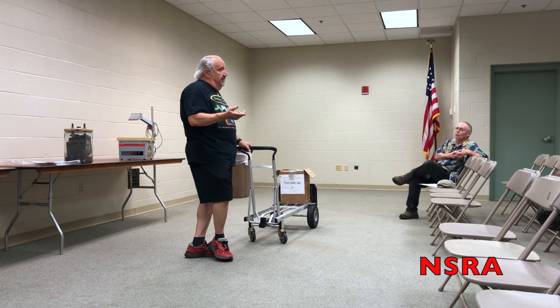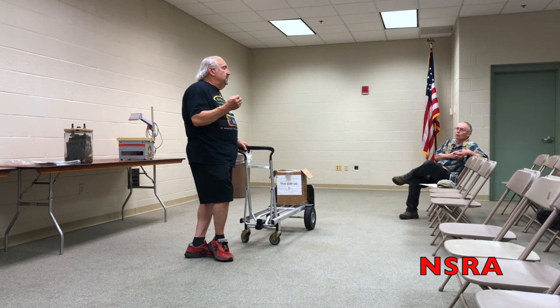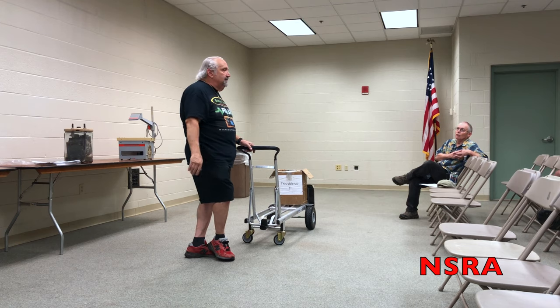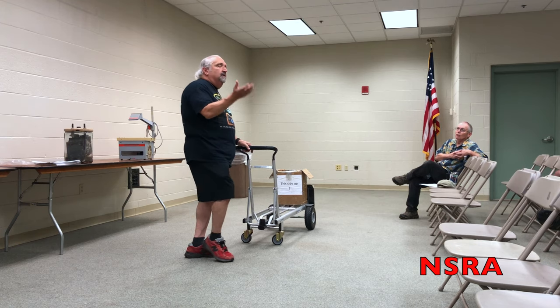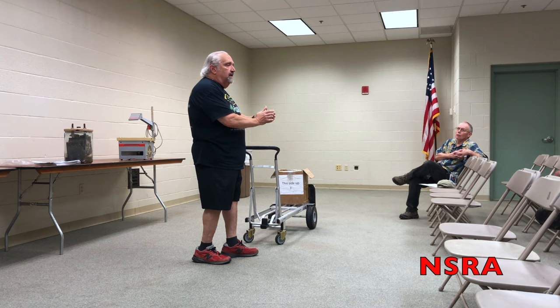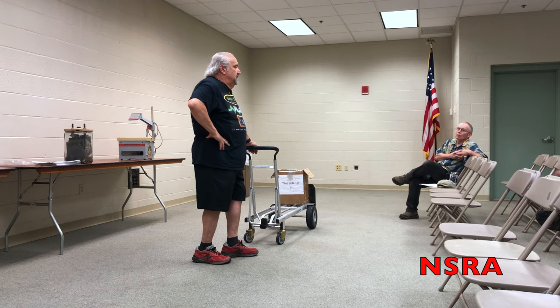Well, if you've got high performance, you want a lot of push, you go for a higher cold cranking amp battery. If you've got a deep cycle battery, then you'd be more concerned with the amp hours. 100 amp hours, you know, is 1 amp for 100 hours, or 10 amps for 10 hours. It's got more storage capability than, let's say, a 50 or a 20 or a smaller battery. And so when you're designing something around that, you want to go for the maximum amount of amp hours if you're talking about a trailer or a motorhome or any of that kind of stuff. Does everybody understand those two concepts?